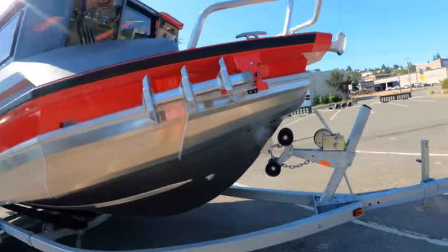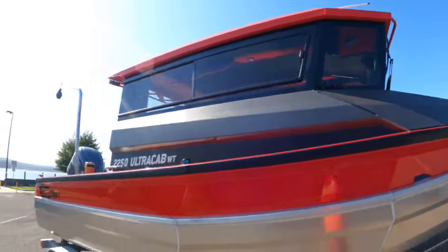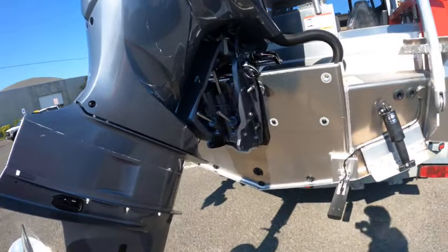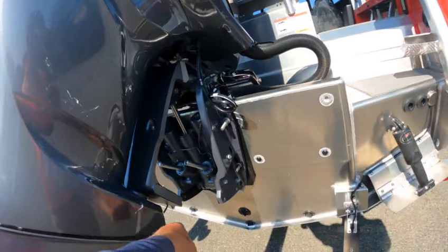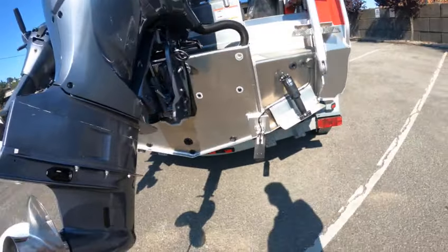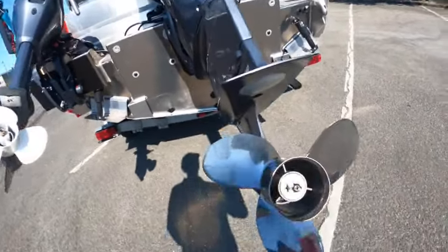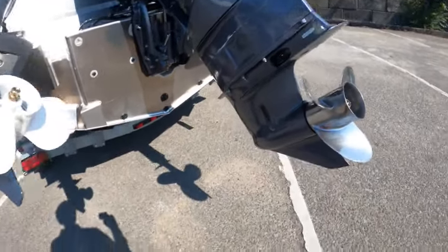These are chambered — you got the life ring and you got your two tubes on each side, and you got a floor so they're virtually unsinkable. Good cleats, forward-leaning window, dual wipers. There's your floor drain, your front life ring, your side chambers — those bottom two you shouldn't have anything come in. You do have the trim tabs, good idea. You've got the Garmin, probably a 56 UHD, 250 V6, with a 15 by 15 stainless steel prop and drive shaft.